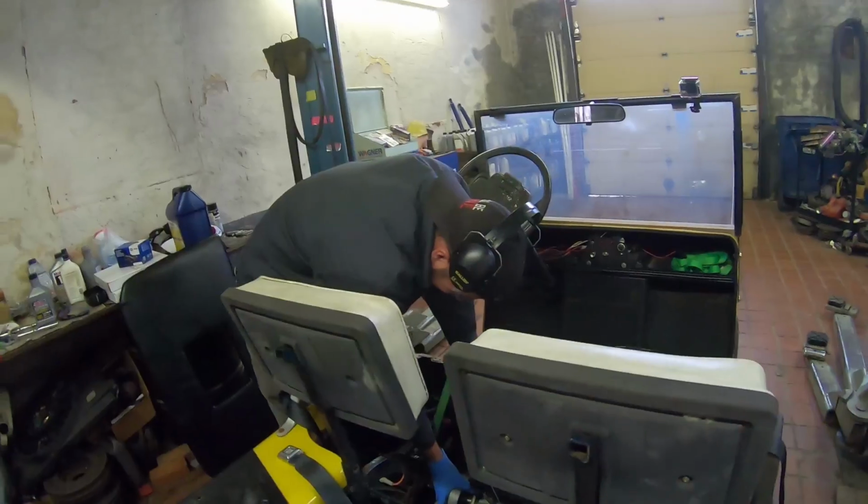So in addition to cleaning this front pulley, we're also going to better space the front pulley and the rear pulley. We're always telling people, make sure your front pulley is lined up with the rear pulley perfectly so that you don't have any belt problems. Well, ours was not perfect, and we kind of paid for it today. Yes, we did.